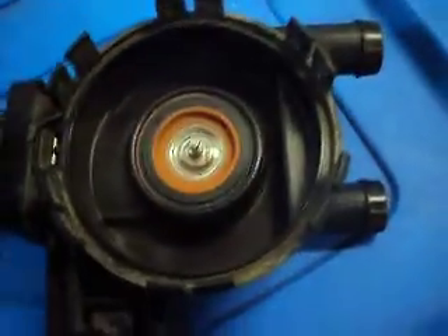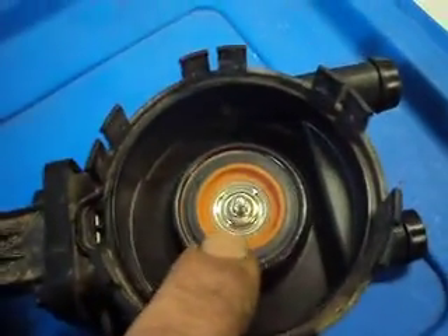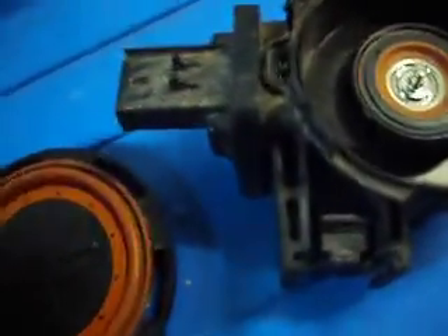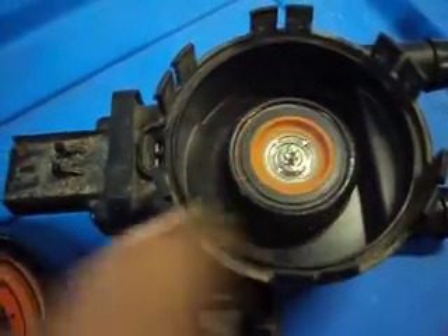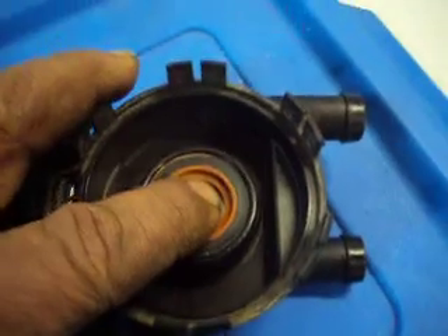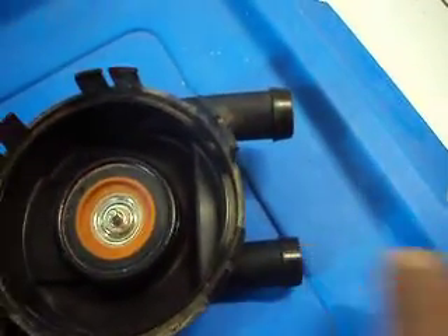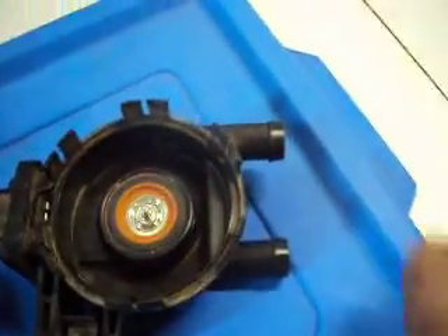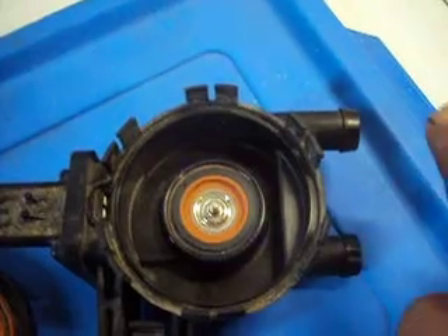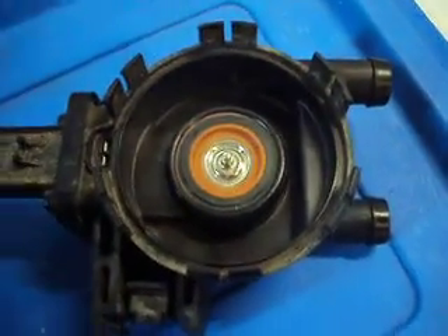In the same way, if you have pressure in your tank, just the opposite will happen. Normally this is closed, so pressure in here would be pushing up on the relief valve, which would then pressurize your tank. You don't want too much pressure in your tank and you don't want to blow the gas cap off. So what happens is that pressure also goes up through where the electrical connection is, and because this here is a larger surface area than this here, even though you have equal pressure on both sides, the larger surface area will push down and this will then act as a relief valve to relieve the pressure in the tank. And because this is hooked up to the canister, the air that's in the tank is being filtered through the canister so that the air that exits on the vent side is actually filtered air and should not have that many hydrocarbons — those should have all been captured in the canister.